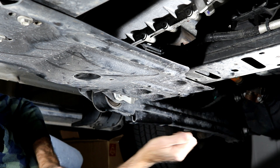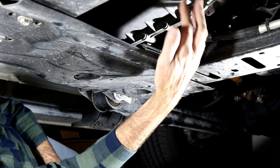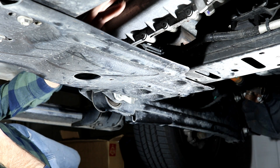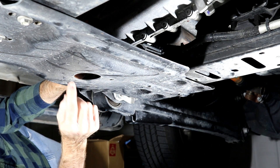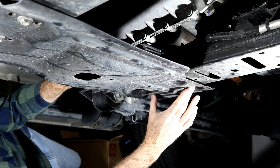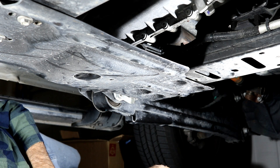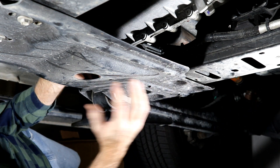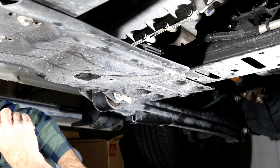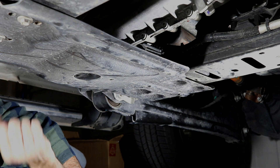One thing I failed to mention — I've got this plate right here, this brace that goes across from here to here. Here's your transfer case right here. Your fill hole is right up here, your drain hole is down here, right under this. So what we're going to do is pull these four bolts off so we can see things a lot better. We won't have that oil dripping all through the holes and making a big mess. It'll make it a lot easier and a lot easier to see also.